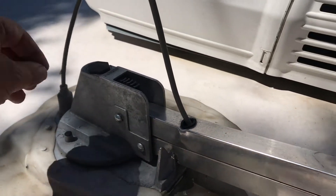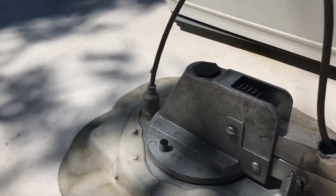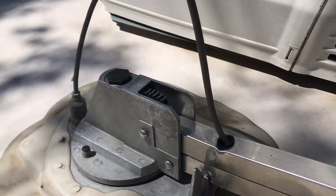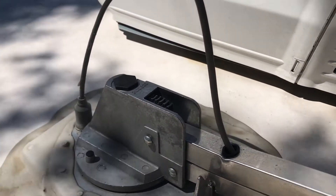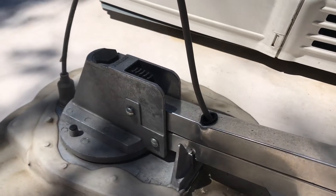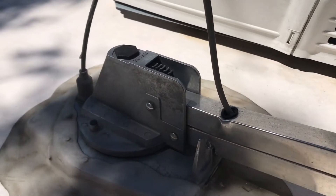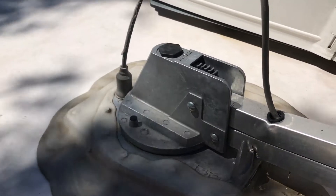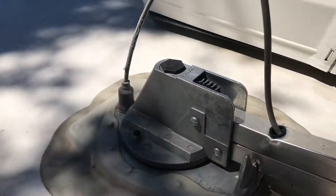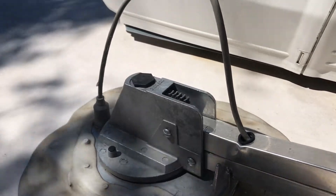Since I was doing this repair, I figured I might as well take the opportunity to replace the worm gear and the elevating gear as well. What happened was as I was lowering it I was tightening it and it started hitting. People always say you shouldn't force things — well, I guess I forced it. I didn't break the handle, but it has a rough opening action and every revolution it seems to get snagged.